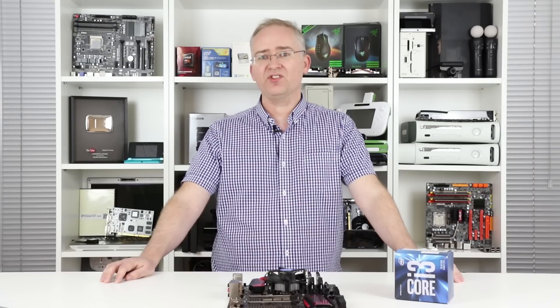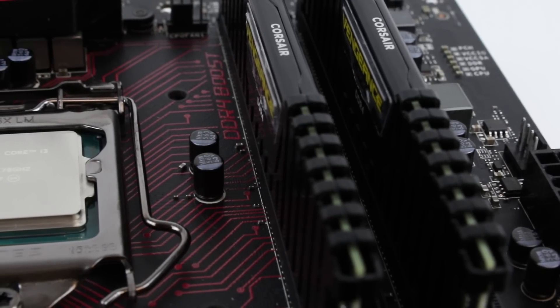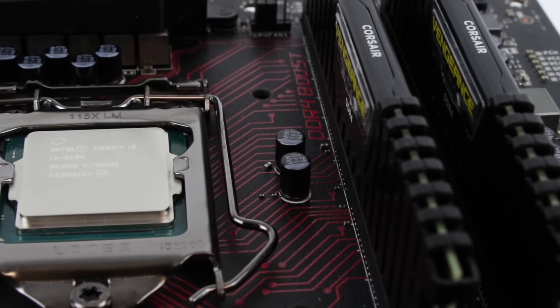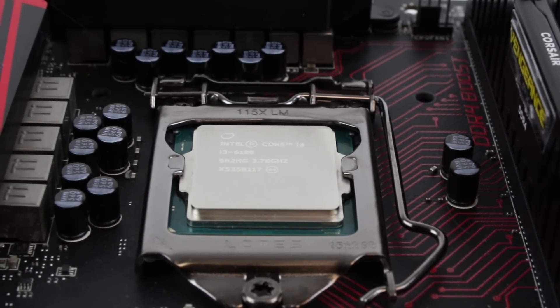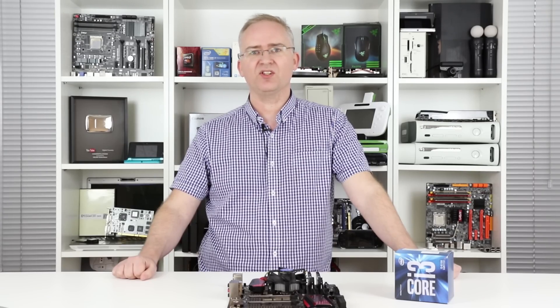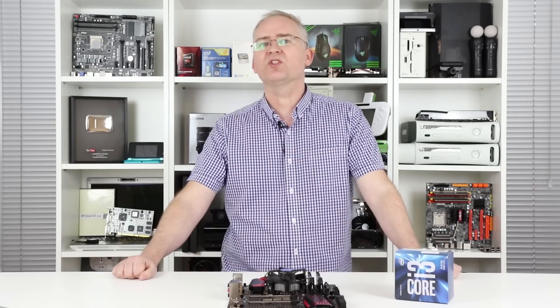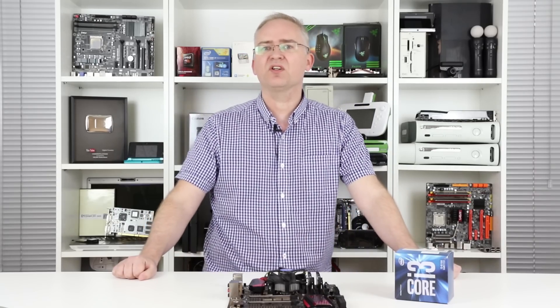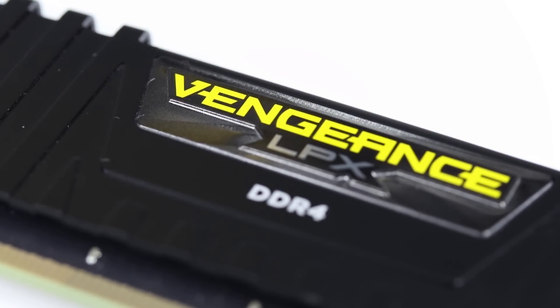As for the AMD FX 6300, unfortunately our motherboard wouldn't let us run faster RAM. We came into these tests hoping we could overclock the Core i3 itself, but the bad news is basically you can't. We managed a mere 2% uplift using the base clock — an extra 77MHz — which isn't really going to be a game changer. But what surprised us is that there is actually an overclocking route available; it's just not the one we were expecting. Faster memory in CPU-bound situations definitely helps.